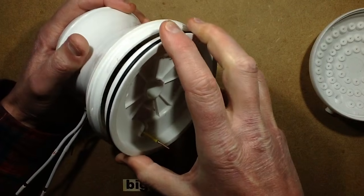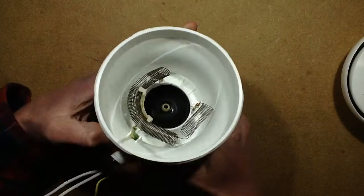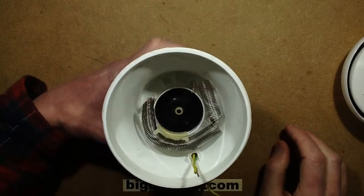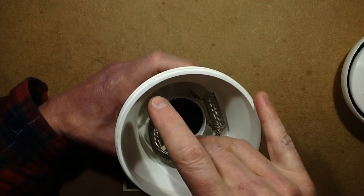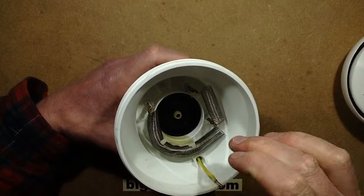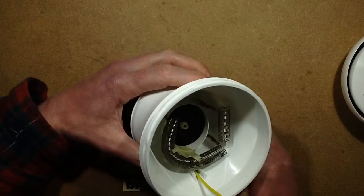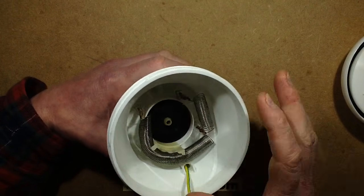The earth wire comes up, and this cover slides off to reveal the bare heating element inside. Bare heating elements in water heating equipment are apparently not that unusual — you get fairly high-power water heaters sold from prominent brands on eBay that also specify water resistivity. The main point seems to be that the lack of an outer shield results in much better cooling of the element, meaning you can run a shorter element at a higher temperature and it imparts energy into the water faster.